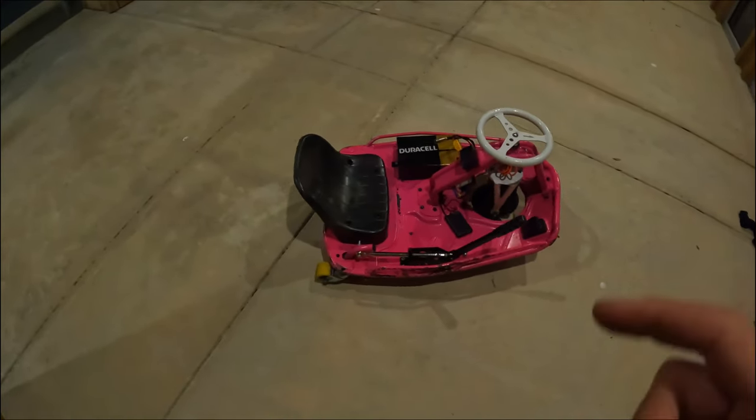All right, so finally, let's get into what setup I recommend for your purposes. If you're just getting into a Crazy Cart, if you're building a Crazy Cart for your kid and they're pretty young, and they just want to get a little bit more battery life, a little bit more speed out of the cart, definitely go for the 36 volt battery and controller combination. That is easily the best mod if you're in that situation where you're building a cart for your child, or you have one sitting around that you want to try out upgrading. That's definitely the cheapest, easiest mod you can do to get started in the world of modding your Crazy Cart.